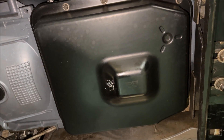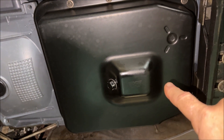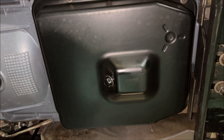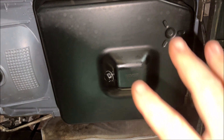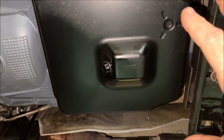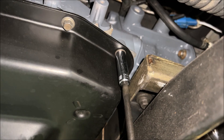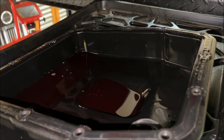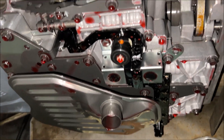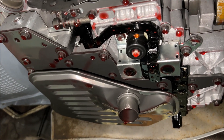In order to do this project I've got to get to the valve body. This is the transmission pan for the 4R70W — this one's unique, it's a Dorman unit that I've recommended many times and I'll link it in the description. It comes with a drain plug, which makes it super easy to get the fluid out so you can reuse it and keep it clean. Otherwise, dropping this pan is going to be a disaster because you've got to keep it level and it'll spill everywhere. This is a much cleaner and easier way to get the pan off, even if you're just doing a fluid change and filter change.